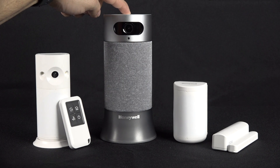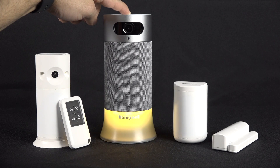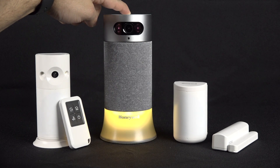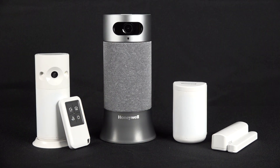A yellow light means that there is a system notification. If you are unsure if your smart home security is working properly, you can press and hold the Mute button down for approximately 15 seconds. You will see that the bottom of the base station turns yellow. Continue to hold the Mute button down until the two infrared LEDs turn on. This will perform a system reboot.